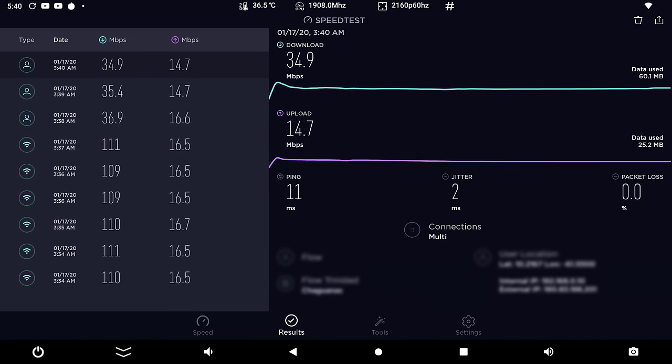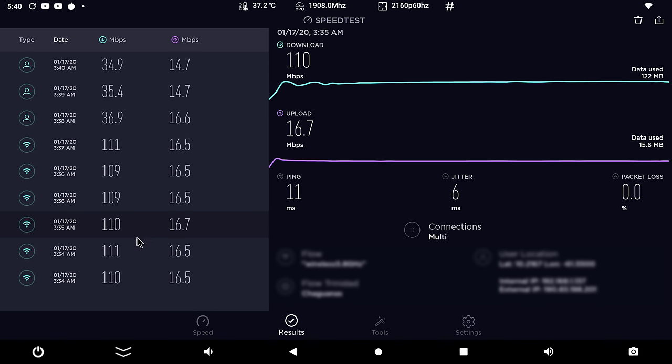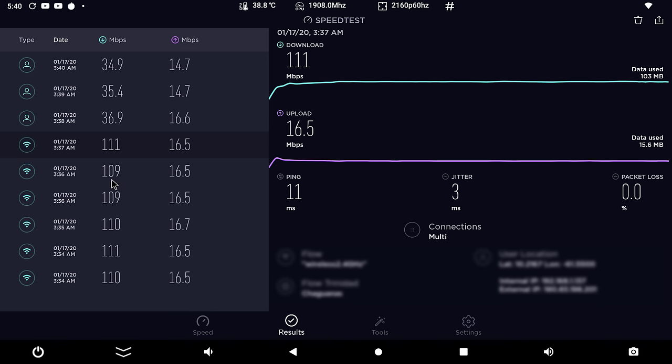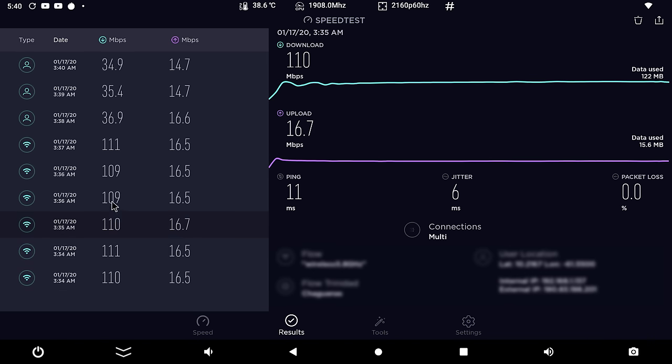Next, I have the results of the Wi-Fi and LAN speed test. The results showed that the box was able to hit the maximum download and upload speed of my internet package of 100 megabits per second on the 2.4 and 5 GHz Wi-Fi bands. The LAN port maxed lower by 60% due to having a max bandwidth of 100 megabits per second. Magicsee has indicated that they have released a second N5 Max model with the 1000 megabits per second LAN port, see the link in the description area. So in this model, for the best internet speed, use the both Wi-Fi bands.